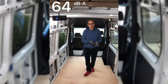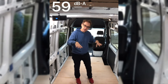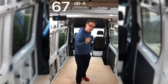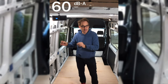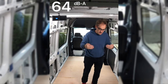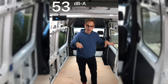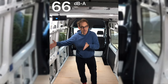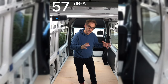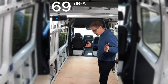That's the second test — we'll see what the numbers show. It sounds and feels a lot quieter, which may have to do with how much of the high-frequency road noise is coming through the floor. Sound pressure level decibels aren't necessarily a measurement of what we perceive as loud, because a high-frequency sound can seem much louder than a low-frequency one at the same dB level. I'm going to see if there's a way to measure not just overall sound but the specific frequencies, because higher frequencies are easier to hear but also easier to damp down.